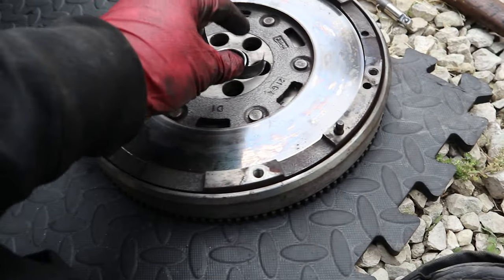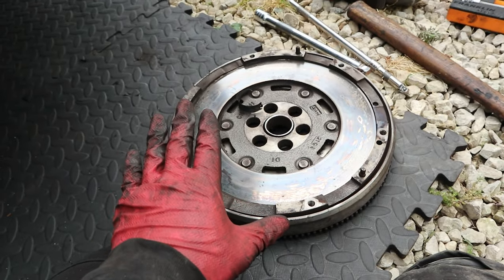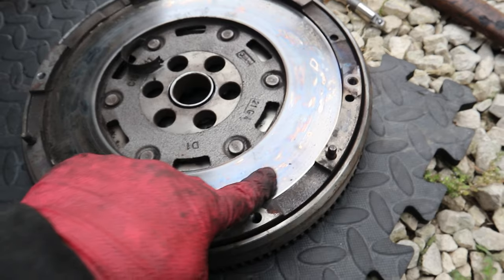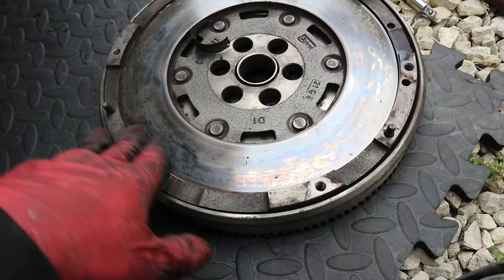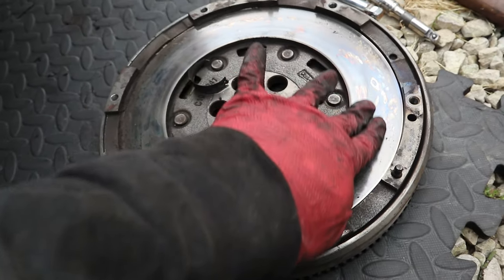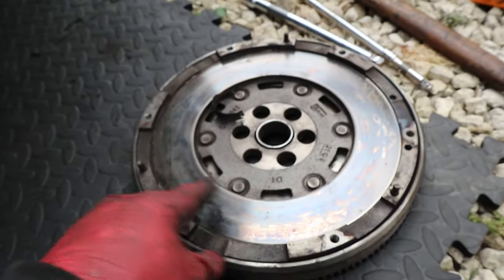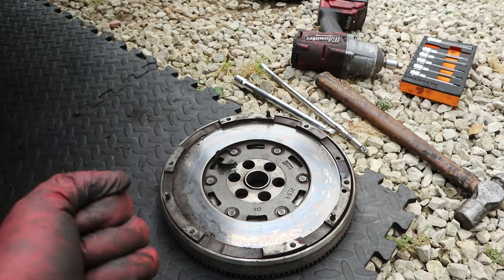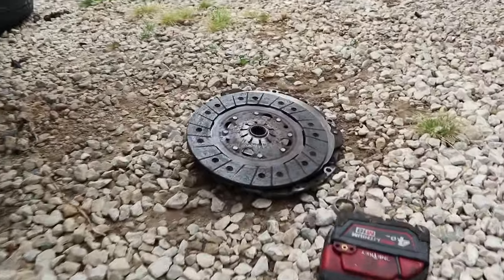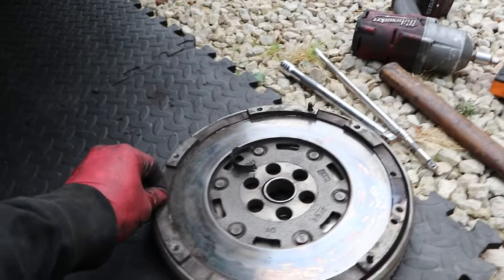The flywheel is out and it's in bits. This usually happens because people hold the clutch on a hill — and funnily enough the customer actually admitted to that. As you can see, there are burn marks in it, which tells me that's exactly what happened. They were using their clutch as a brake to hold the car uphill, and this is what happens. The clutch is wearing down too — it's starting to lose the grooves. We'll advise the customer not to do that again.